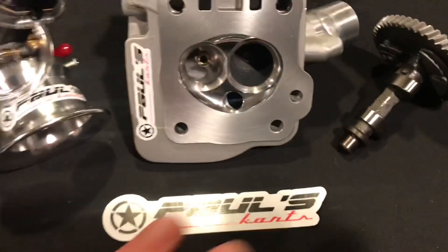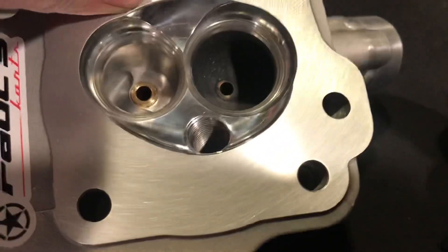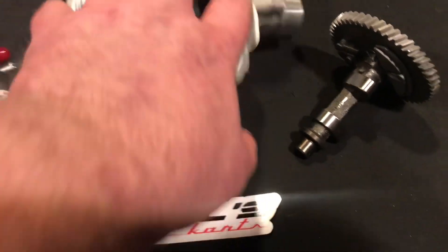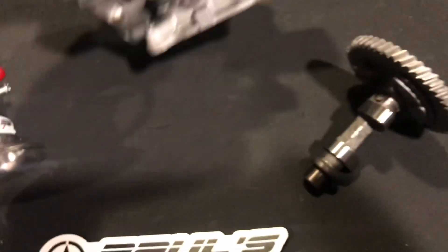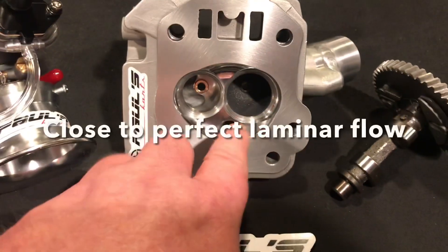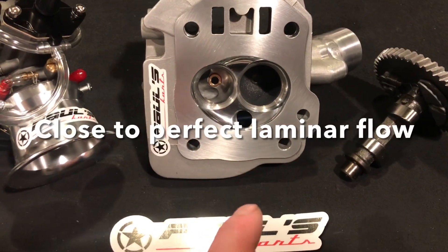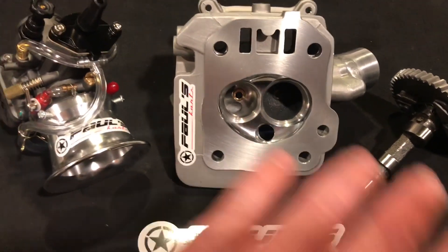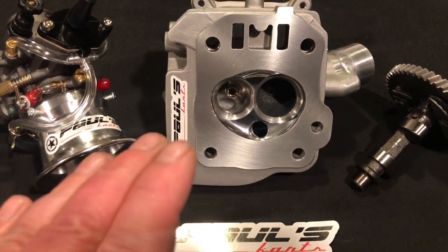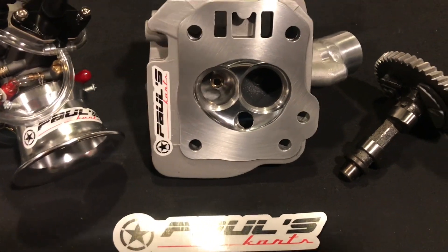Back to the head — this actually comes with the epoxy port polish chamber. You can see this thing, it's like a mirror. The shine is just crazy. The bronze guides are reamed at home, and the intake guide we even take a step further and spiral shape it. Looking down the port — just phenomenal. Even texture, perfectly straight walls, no waves. We actually do the bowl of the intake port on the mill using a 60-degree ball mill that we had specially made to that exact size and shape we wanted so we could duplicate it every time — precision, repeatable, duplicatable results. We run that in the bottom of the bowl on the mill to get a perfectly radiused back end the way we want it.